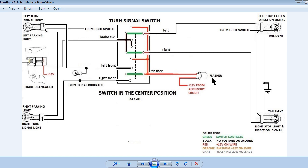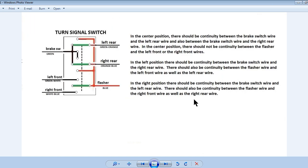Notice that with the turn signal switch in the center position, there is no electrical path for current to flow through the flasher. When troubleshooting the turn signal switch, there is a connector at the bottom of the steering column that may be disconnected. Once disconnected, the turn signal switch can be continuity tested in each position. I will not repeat the explanation of the flasher operation on subsequent slides, so keep this in mind. The colors shown are for Mustang or Falcon — consult your vehicle's wiring diagram for wire colors.